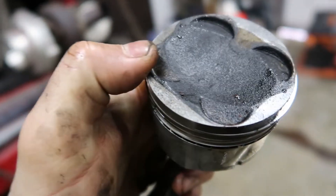What we could do is pull all the caps off the pistons, whip them out, mark them up, have a look at the shells, have a look at the crank, and take off the mains as well. Naturally, we're gonna use the only tool for the job. A wee tip — it definitely helps if you have the right size on there. If you just crack them off a little bit and then split the cap and the rod — give them a little tap like that. See? Now the shells and everything will come out easy. But yeah, the size don't look good — that's shell there. This is gonna be pretty messed up.